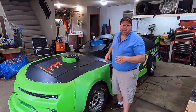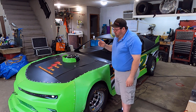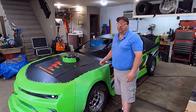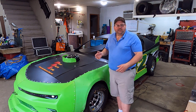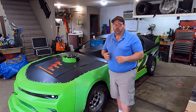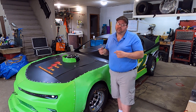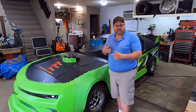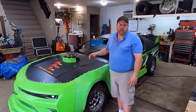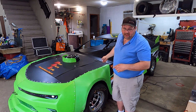Technically, if you did this perfectly, you'd take one rear axle out so there's no bind between the two rear wheels, and you'd take the shocks loose — specifically any gas shocks. The only shock I've ever taken loose where I could see a difference is an AFCO extremely high nitrogen-pressure left rear shock — around 200 PSI — I can see that on the scales, so I unhook it since it doesn't act like that on track. But these standard shocks I don't unhook. Technically, perfect scaling means no shocks hooked up and one axle out.